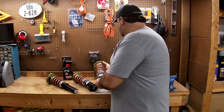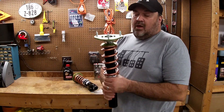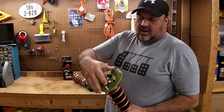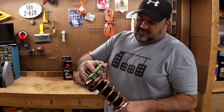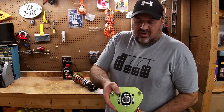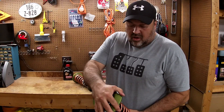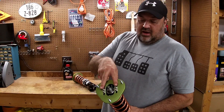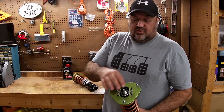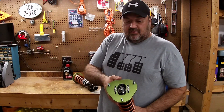This is one of the rears, and this is a front. What's nice about the front is it comes with a pillow ball type mount, and it's pretty stiff. You can actually adjust the camber on it, so there's no need to upgrade to a GT3 style lower control arm unless you want to widen your track. You can get maybe a half a degree or a little bit more, and I'll find out when I bring this in for an alignment.